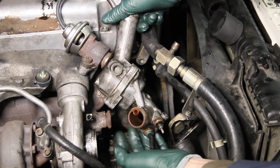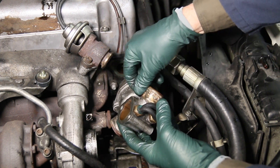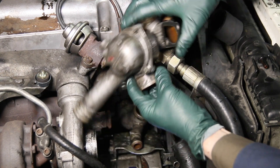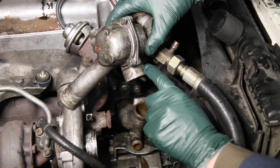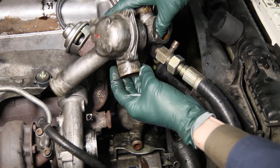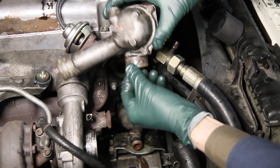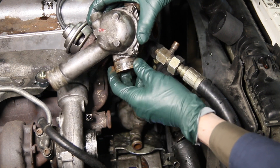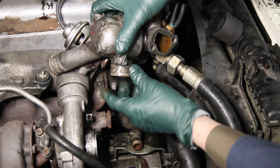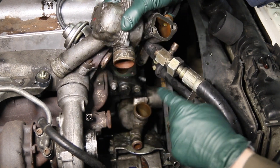The second reason is the corrosion on the aluminum parts. Look at the corrosion right here on the upper radiator hose fitting — it's all rough, and it probably wasn't clean when the hoses were replaced. Then look at the corrosion on the short hose nipple — it goes all the way around and it's deep in that aluminum. With this much corrosion on your housings you're going to either have to find a good used replacement or do some modifications and repair work. I'll put a link in the description with more information on how to repair these.